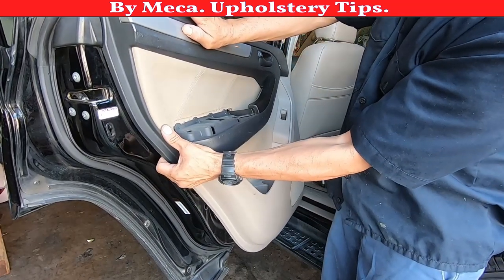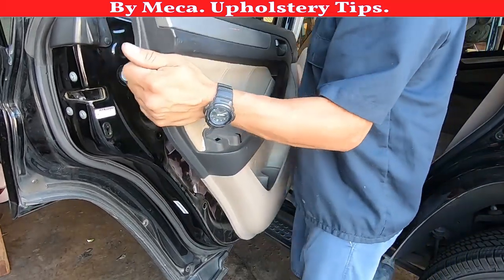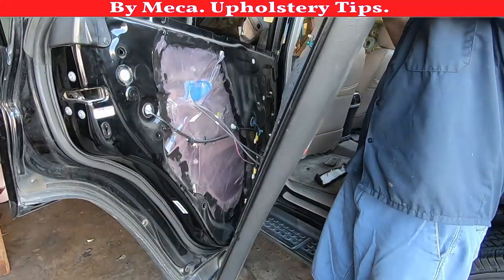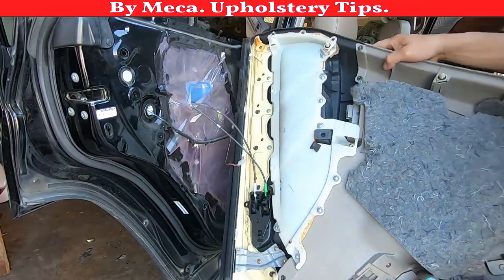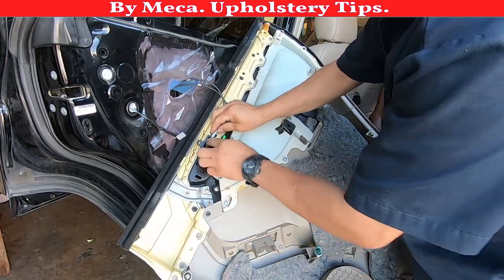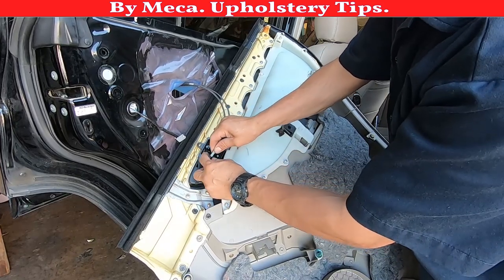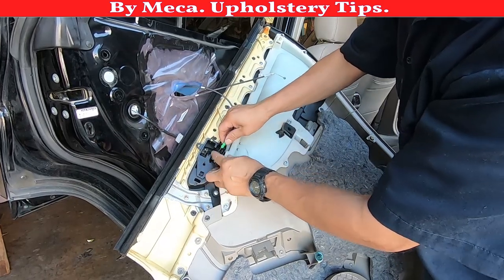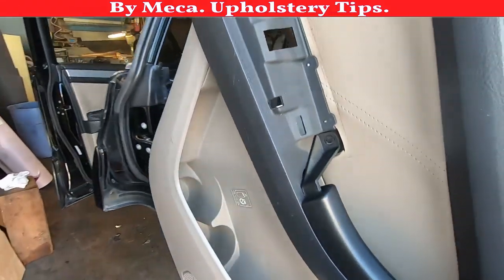Now you just have to pull out the door panel — you can hear it click. I just pulled it and the door panel is out. Now we have three connections: one for the light. In the Toyota 4Runner there are two cables — white and green. The white goes on top always and the other goes on the bottom. Make sure to disconnect them. That's easy to disconnect. Now I got both cables out and the door panel is off.